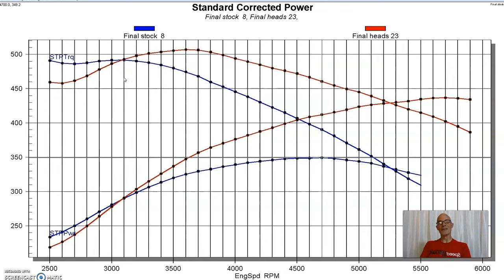But we wanted to go even farther. So we wanted to show somebody what could be done to really get a lot of power out of a 460. And what we did was, we didn't go the whole stroker route, but we took everything apart, took our short block down to the guys at L&R, and I had Derek bore it 60 over, and then we put a set of flat top pistons in it. The thing cleaned up nice, and the guys had a 60 over flat top piston with valve relief in it that allowed us to run even more camshaft, because that was really the key. The short block prep was kind of minor compared to what was going on, but we put that flat top piston in to bring the compression up.